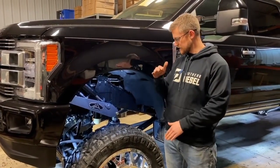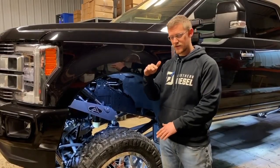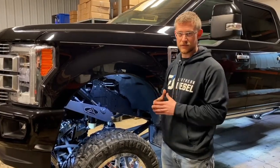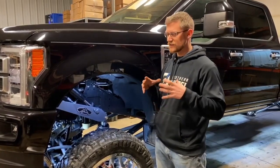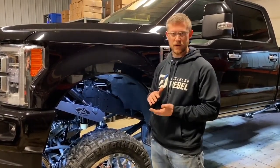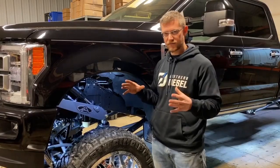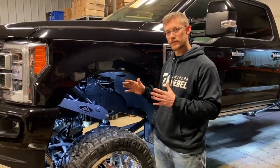And at the end of it, the shock extends through that range. So when you're fully lifted, your shock shaft is pulled all the way out, so you can't really drive it like that without potentially damaging your shock. Same thing when you lower a truck that has airbags — it's going to be on the internal bump stops on the bag, and your shock's going to be compressed, so that's really not going to let you drive with it all the way down either.